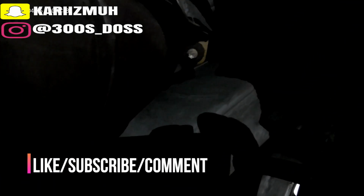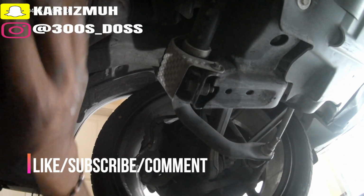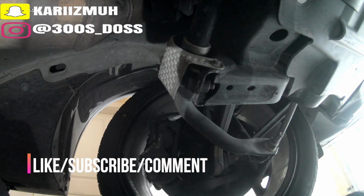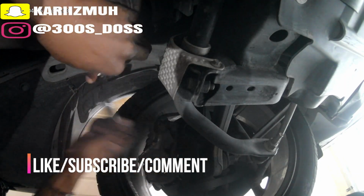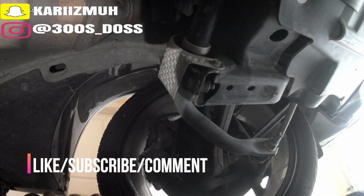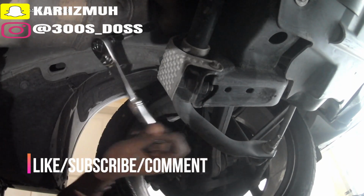So right there, you see that bolt? He's gonna get that bolt. So I just got a breaker bar, medium extension, and 16 mil. You should be able to take that right off. I already broke the bolt. So now, get my ratchet. Once again, it's a 16 mil. This should just come right off. It looks like it has a special type of nut on there. Oh, it's coming off. Let's see. Oh, no, it's coming off.